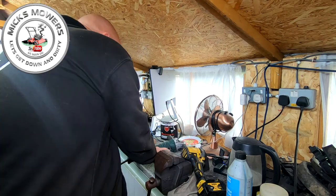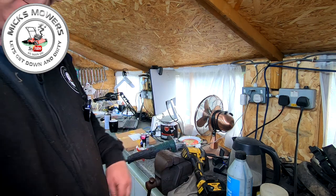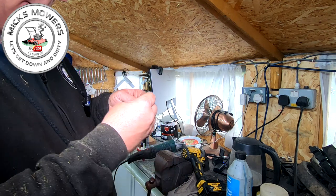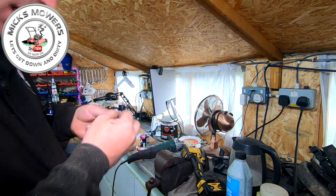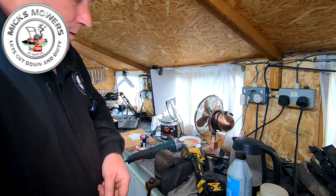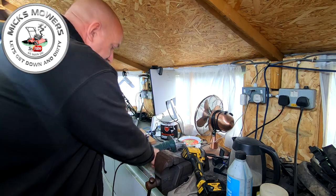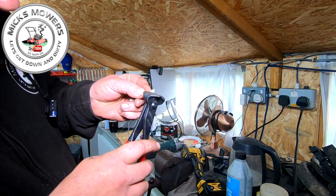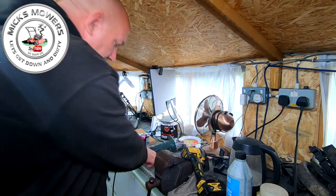Now what I'm hoping is, when I thread my spring back in through there, it then comes all the way up, and I want my spring to sit inside it. So that's just a little bit too big, okay? I'm going to get my Knipex again, and ever so gently, take another little sliver off. Try that. I want that connector to fit just inside. Now when you get to about the right size, you then cut this end off at like an arrow. So about there, that end will be all right.